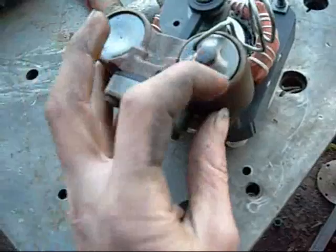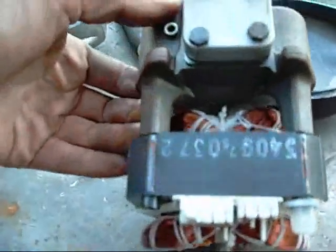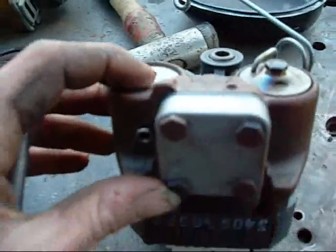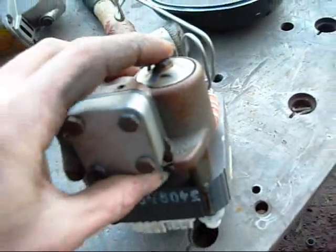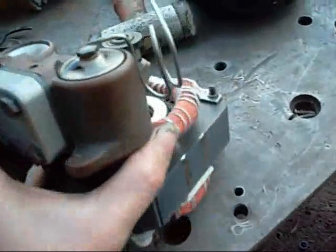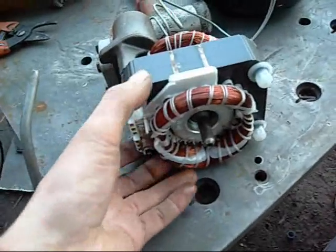They have a piston, a connecting rod, a crankshaft or at least an eccentric lobe on the motor shaft. Sorry — it's got one discharge chamber that accumulates pressure. That's the suction side here, that's your inlet. This is your high pressure discharge — there's only one of them — and this is obviously the cylinder head. Inside that are a set of reed valves: one for inlet, one for outlet, and they check the flow as it comes through.